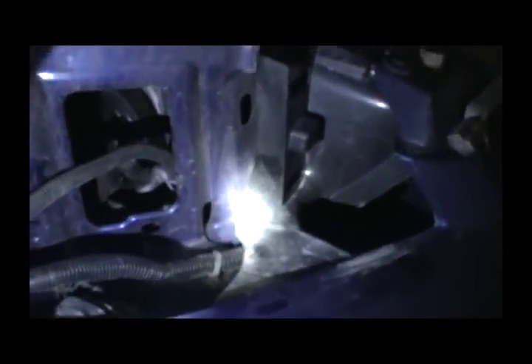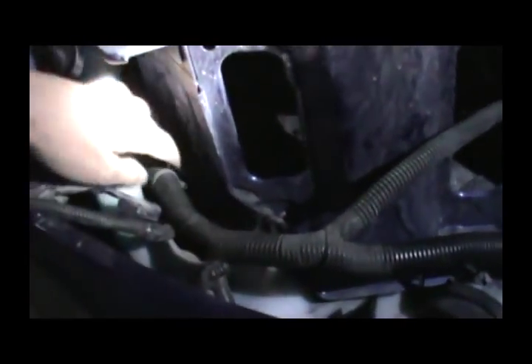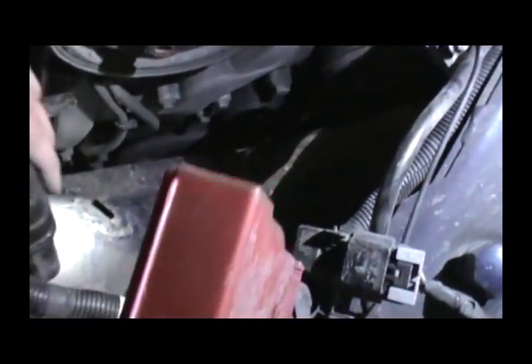I removed the headlight. When you remove the headlight, you will see the harness. I had to actually cut a little piece of plastic here that holds the wire, as you can see here. I cut this to give myself slack so I can pull this wire and be able to pull this thing out of the way, because I couldn't pull it — there's not much slack. So anyway, the dumb battery is out.